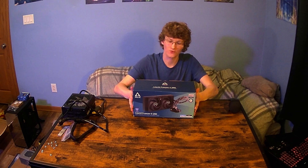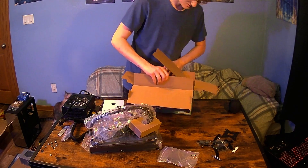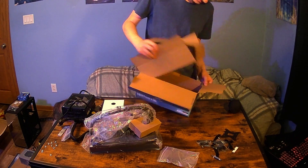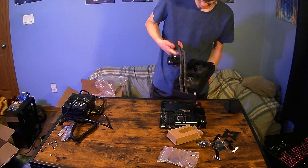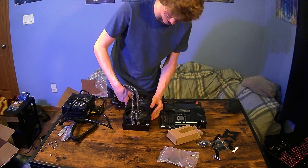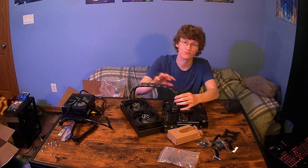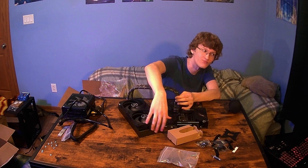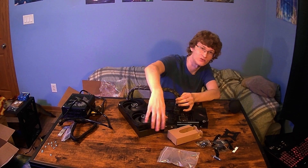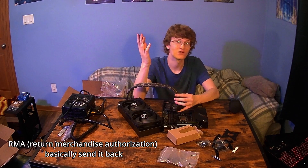My next step is to identify whether I need to put this on the motherboard before I put it in the case, or if I can do it after. I've got a medium-sized case, which I'm hoping this will fit in. The orientation that this takes is also extremely important. AIOs all have some amount of air in them, and that's going to collect in some part of the system — you want that to collect right here, which is usually the best area. So you want this to be the highest point in your build so the air collects there. In other places, you could end up with performance loss, a reduced lifespan on your cooling unit, or you may have to RMA it.